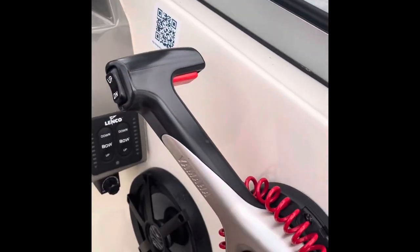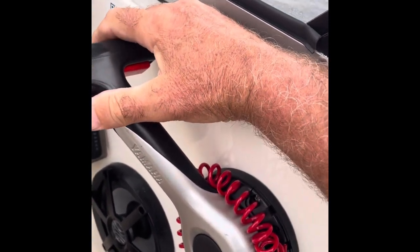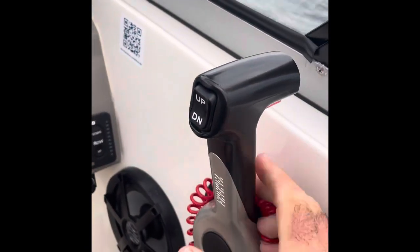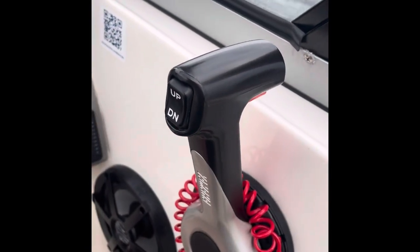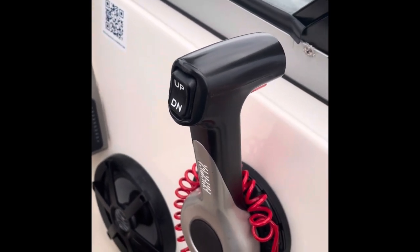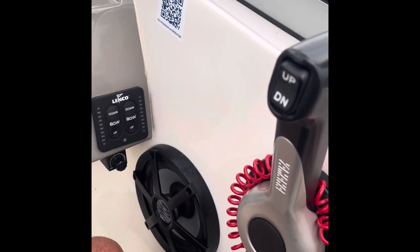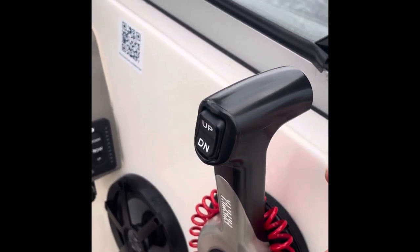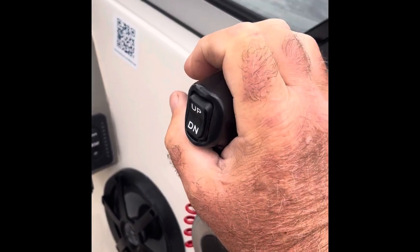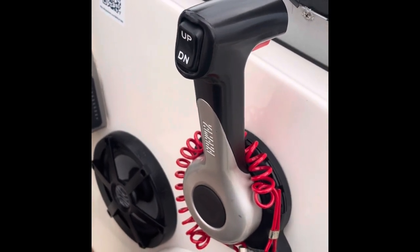So if you're having this trouble with yours, you might want to take it apart and try this. I think this controller just has innate built-in slop. So many writeups I've seen on threads about people trying to explain the friction thing, and all they keep getting told is 'just tighten your friction screw.' Well, that's not the problem — it's the slop. This did sort of fix it, not entirely, but it might not get any better than that. Hope you enjoyed the video.